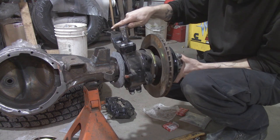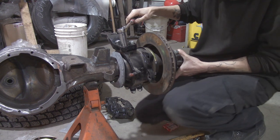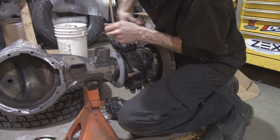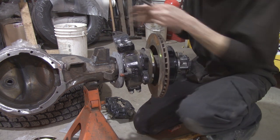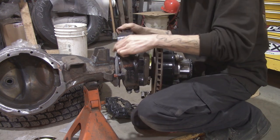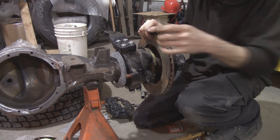And you're gonna wanna be careful that this doesn't rotate either if you're on two jack stands like I am, because it will fall off. And my socket's not fitting on all the way because I beat the crap out of this steering arm trying to get the cone washers out before. Definitely looser than you. Oh, it's because I didn't tighten up the bottom. Tighten up the bottom first. And of course, I snugged it down, so now the cone washers are really doing their job, doing exactly what they are designed to do.